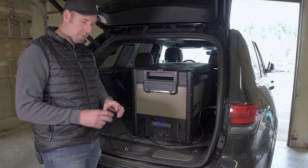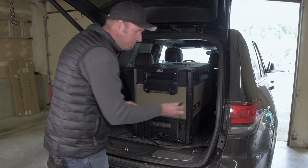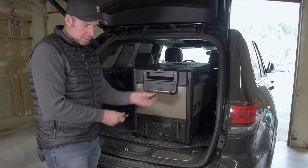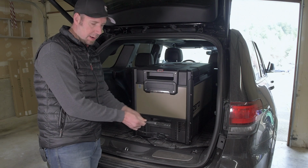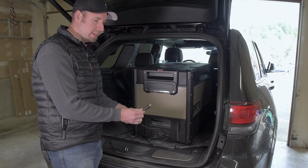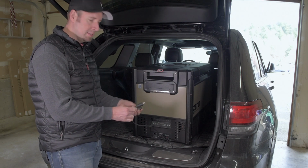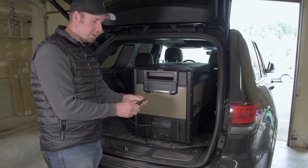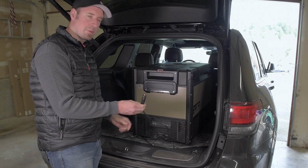You plug in our fridge power cord, which actually has a threaded piece that allows you to thread right into the outlet that we provide with our wiring kit, so that you get a vibration-free, secure system with plenty of gauge wire to allow plenty of voltage to your fridge to run all day long.